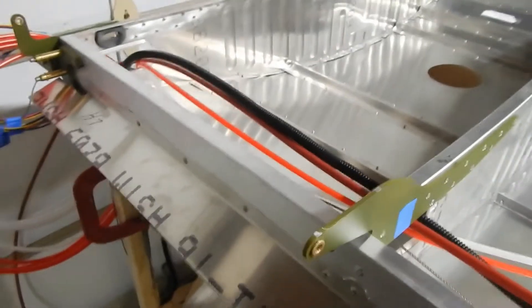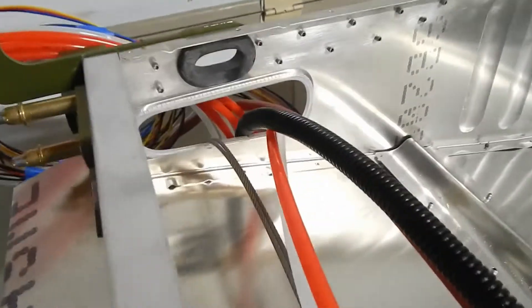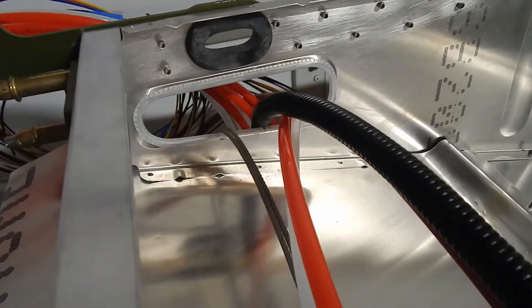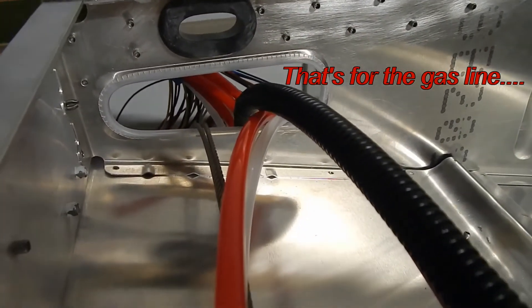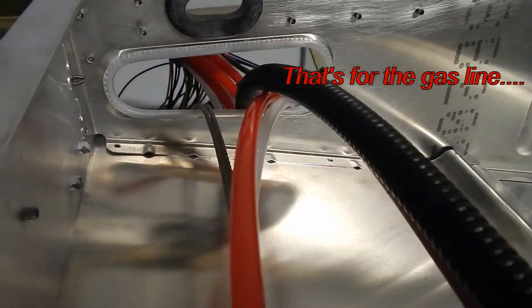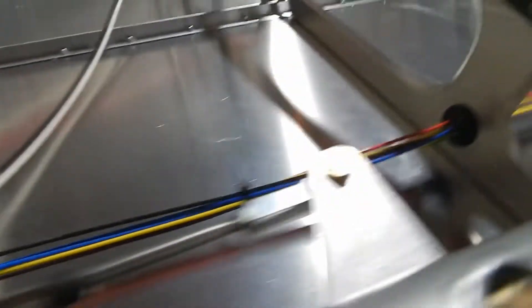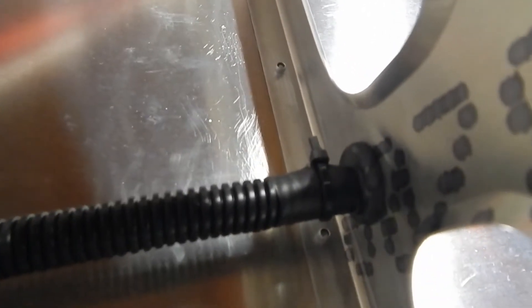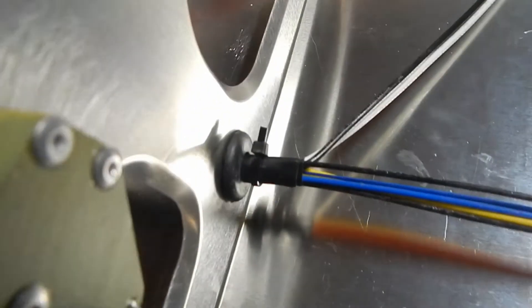After knocking off a punch list on the left wing: first, I rerouted my wire looms, pitot tubes, etc. I had them through that little hole with the grommet on top, but I saw other builders running them through the larger hole below, so I assumed I'd made a mistake. I also put a loom on the electrical wires — this black item running up to the third rib. I taped it and then put a zip tie on top of the tape, so if that tape gives way in five or ten years, the zip tie will hold it. Did the same on the other side.